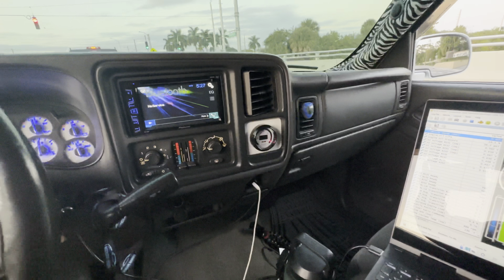It's done writing, so we can close this. I had to go into the speedometer and make sure that this was 390, which it was. And then the other thing I had to do was go to the gear tire wizard and change this to 27.8, and that's the rear tire size and the gear ratio for 390. I had these two checkboxes, so it'll calibrate.